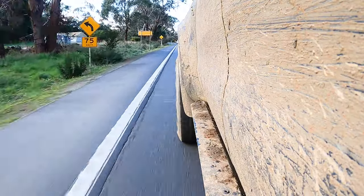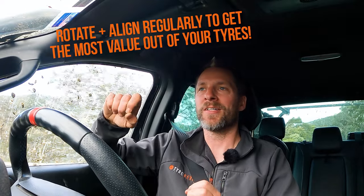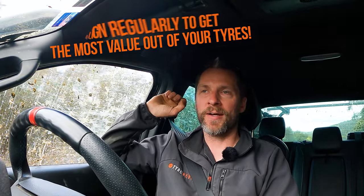The other question is road noise. Yes, there is road noise — I definitely notice it. Coming from the Toyo AT2s, which are slightly more aggressive than standard all-terrains but very much a road-oriented tyre, there is definitely a marked noise increase. That said, it's just a background hum. Through the 17,000 k's I've been running these, they've gotten a bit noisier and I've rotated and aligned them — I think you really need to keep on that. If I didn't rotate and realign every 3,000 k's they would start to sawtooth, get noisy, and you'd ruin your investment. These tyres are actually really good at almost everything.